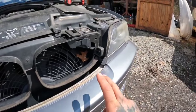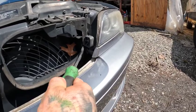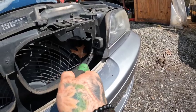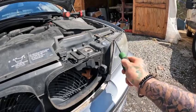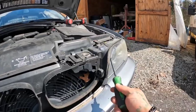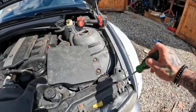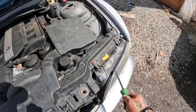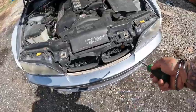To get this front bumper to come off, you're gonna want to take this plastic piece off — there's a little tab inside here, so you push it in and then pull this plastic piece out to give you access to get the headlights. We are gonna get new headlights for this, so I'm gonna pull these off and set them to the side. We'll put them back in until the new ones come in. There are bolts right here, and if I come across anything else I need to take off to get the headlights out, I'll notate it.